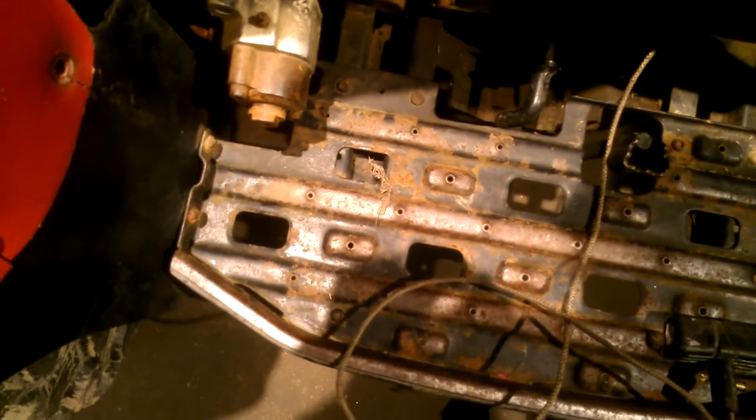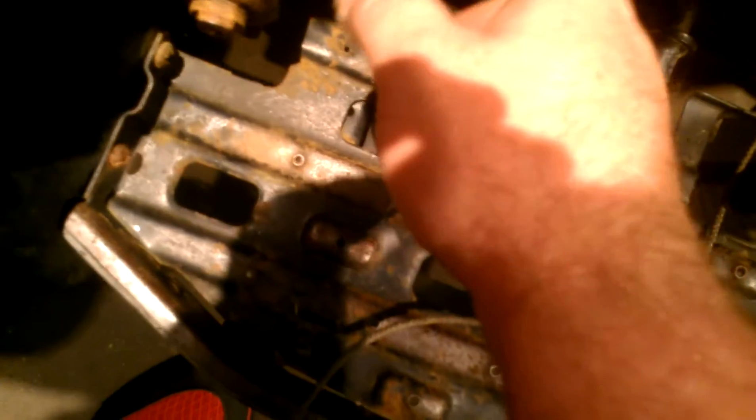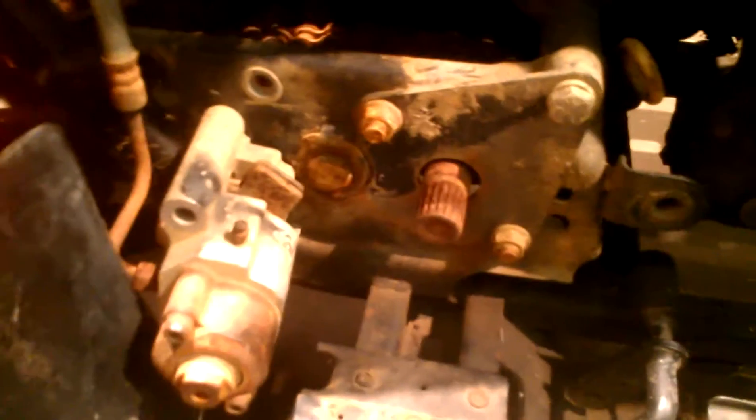What I was told was that it needs the brakes fixed. We've got a caliper there — it's got calipers on them. I don't know if it just needs to be sorted out. It's got front brakes, it doesn't have back brakes. This is not attached. The pads are no good, so it needs pads for sure. I'll bolt the back one here. I'm guessing a sprocket goes there, or a sprocket with a rotor. It's been a while since I worked on one of these. I'm thinking a rotor goes there, and there's a cover that's supposed to be here so that's not exposed.